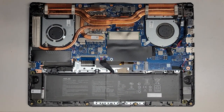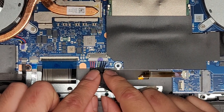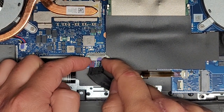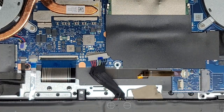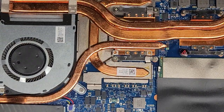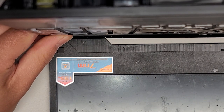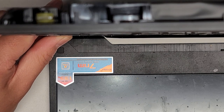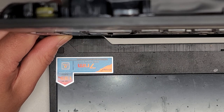If you're working on the computer and you're not very confident or somewhat clumsy, you might want to disconnect the battery first. The battery connector is right here — you grab the edges and wiggle the connector as you pull, and it pops out pretty easily. After doing that, to be safe, open the computer slowly because each hinge is missing a screw — if you open it too quickly you can break the hinge mount. Then press and hold the power button for about 15 seconds to drain any residual power from the board, making it a lot safer to work on.